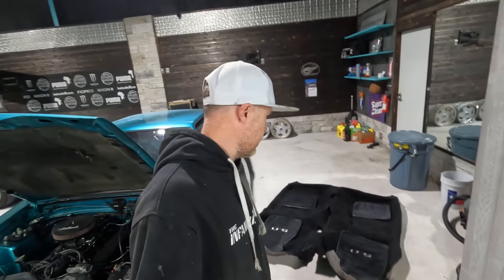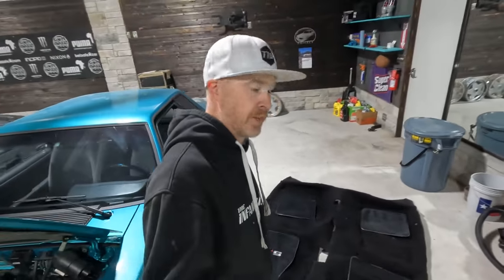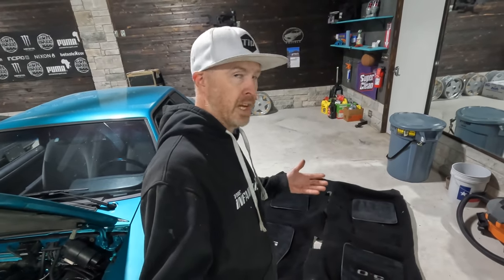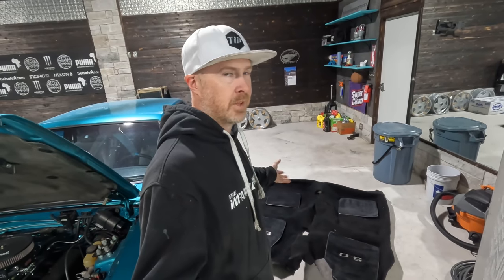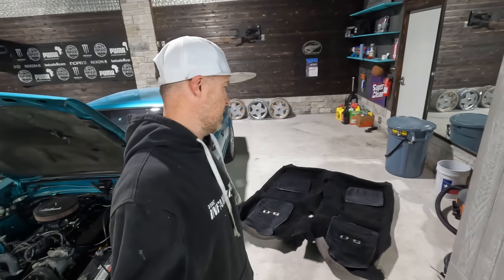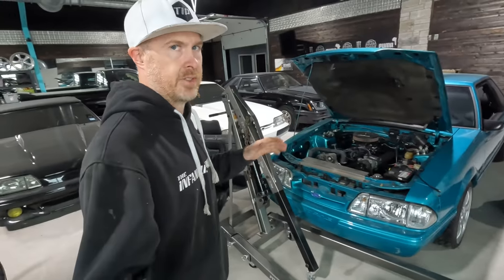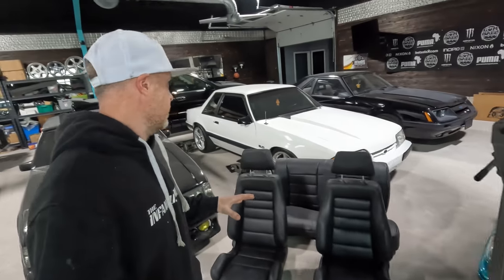Time is here — it's been a couple of days. I've just been busy catching up on some other stuff. Behind me down on the ground you can see the result of the carpet — I got it all vacuumed up. It's looking nice and black. I'm really happy with the way it turned out with the RIT ProLine formula. My recommendation would be to actually use two bags or two pounds of that formula, just because the carpet did have a little bit further to go — it was on its way to black but wasn't 100% there. With that final dye attempt, things came out the way I liked. Try for the hot water and you should end up with a pretty nice result. The carpet literally looks like new.